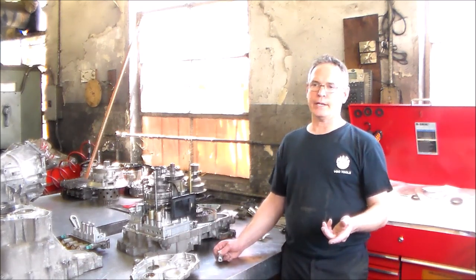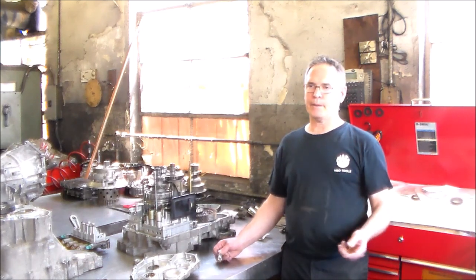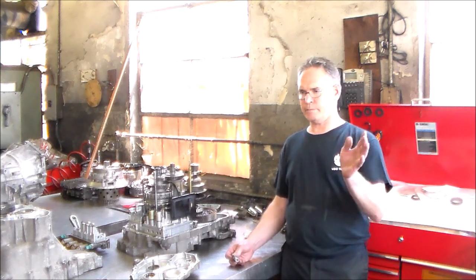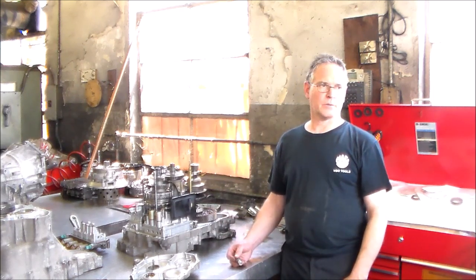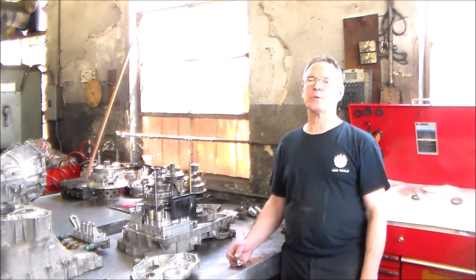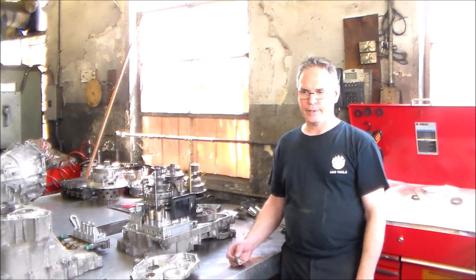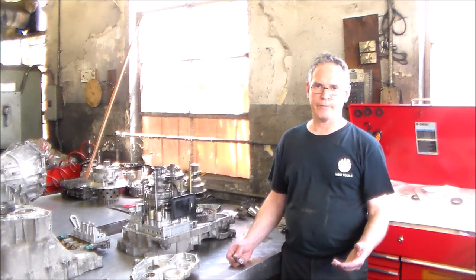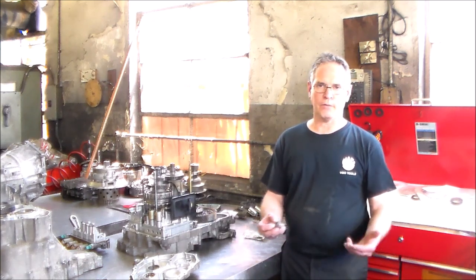When we did this 09 Honda Pilot, I called them up and said I want the second, third, and fourth pressure switches. He said no problem. I asked why they stock all that stuff and he said these switches fly off the shelf. They do have a high failure rate — that's another reason why we do all of them versus just the one for the code.